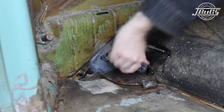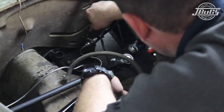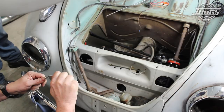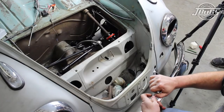While our pedals and master cylinder were out, we cleaned up the rust on the front firewall and sprayed some primer on the bare metal. With the master cylinder bolted in place, new front brake lines are bent and attached to the front left and front right brake hoses and threaded into the ports on the front of the master cylinder. I bend the lines by hand with a soft touch and use a wrench for leverage on tight bends. A brake line bender is recommended if you find that you kink the lines more often than you actually bend them.